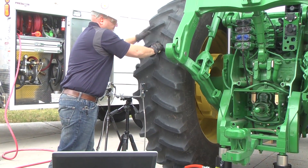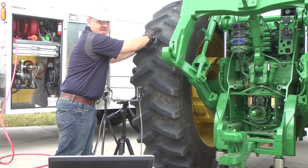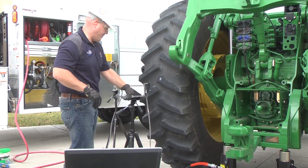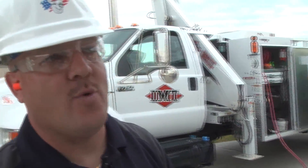Right now it's measuring every lug and in between the lugs, all the way around to a 360 degree point. Then we'll do the rim. The TIR on that one was 0.4 something, so you want to get as close to 0.157 as you can get.